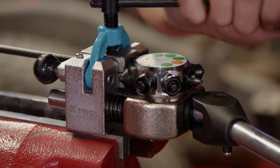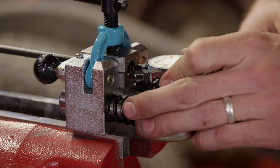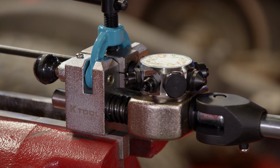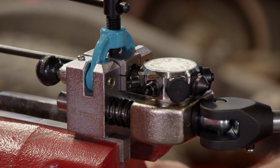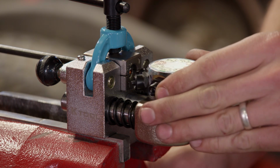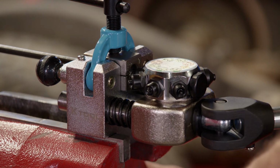With the line in the correct position and secured, we rotate the die head to the size that matches the brake line diameter and first form what's called a bubble flare. Lastly, we rotate the head to select the 45-degree inverted flare die to complete the end of our brake line.